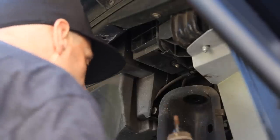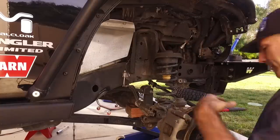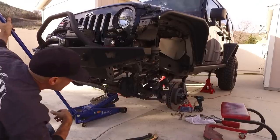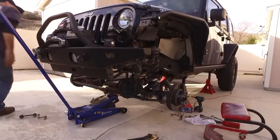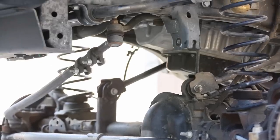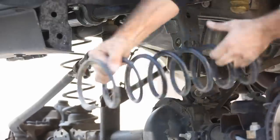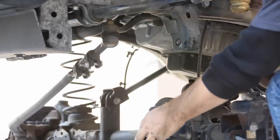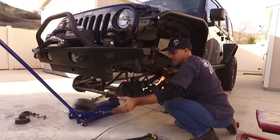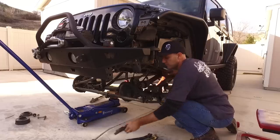Now for the fun to begin — let's lower this down and watch everything to make sure nothing's getting tweaked. It looks like these springs will be a little tricky to get out, but not that big a deal. Spring spacer gone. This is the stock rubber isolator — you're going to go ahead and reuse this, so save that.